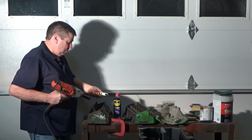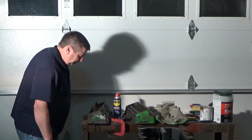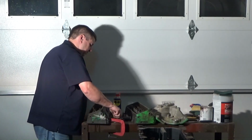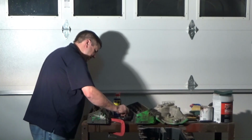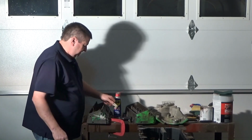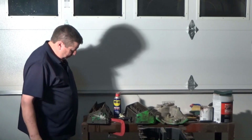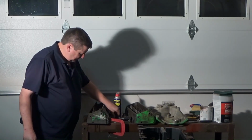The difference it made was amazing. I immediately began removing rocker studs. Unfortunately, I also began to twist off and break rocker studs that were stuck in the head. I had to use a die to thread what was left of the rocker studs sticking out of the head and apply some heat from a butane torch to get those out. It was a long, tedious job, but eventually I got them all out.